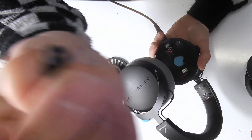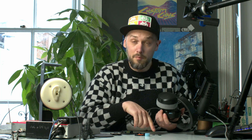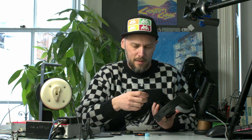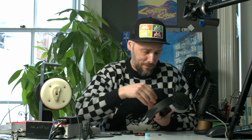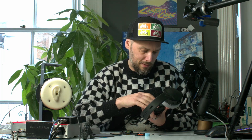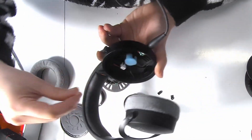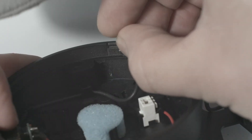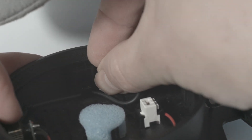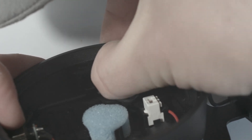The orange disc will allow just the right amount of airflow through - put that over the back of the magnet centrally, then take the central piece and clip that back in place just where the other one was. Make sure everything's clicked in. Inside there are three little stays at the bottom - take this disc of foam, pop that just in the middle and get it central. Then these little tuning pieces - they come with one with a 2mm hole and one with a 3mm hole. Without these you're going to get dirty boomy bass. The 3mm hole one is the best for most listening, while the 2mm gives you a flatter response for studio work.